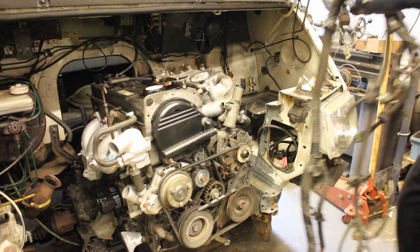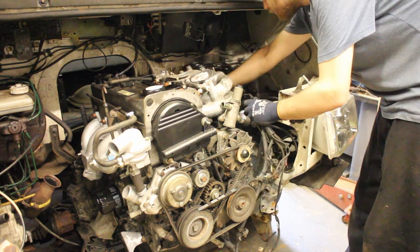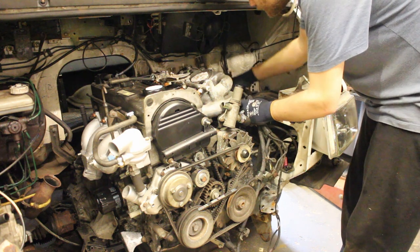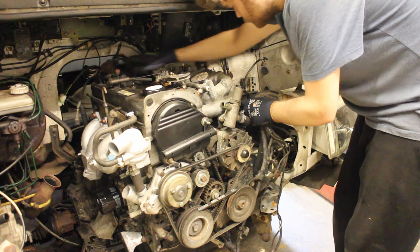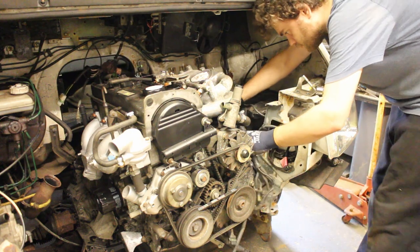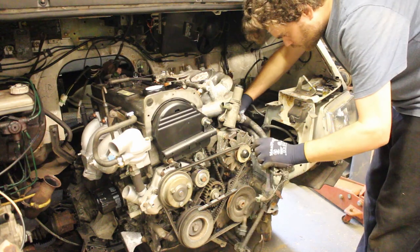Having sorted out the wiring loom in the previous episode, it's now simply a case of fitting it to the van. This is about as simple a loom as you can get for a multi-point injection system, but even so, it helps to break it down into the separate branches. I'll start with this fixing point under the inlet manifold, as this is where all the branches merge before it goes off to the ECU.